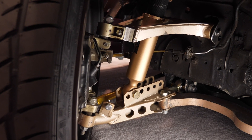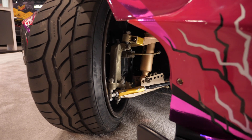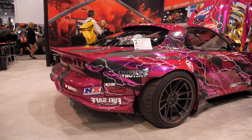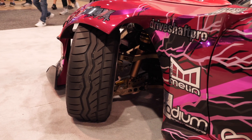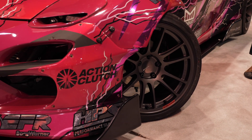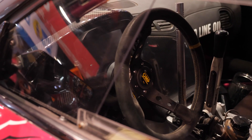It's custom all the way from the lower control arm to the upper control arm to the actual knuckle itself. We had to make something that was drift specific, that didn't bind up, and really just made putting an angle kit on the FD RX7 very simple. A lot of people think this chassis is very twitchy, which makes it not easy to drive. Everything with developing this kit was to try to take that out of it and make it much more drivable, because it doesn't matter how fast the car is if you're not comfortable behind the wheel.